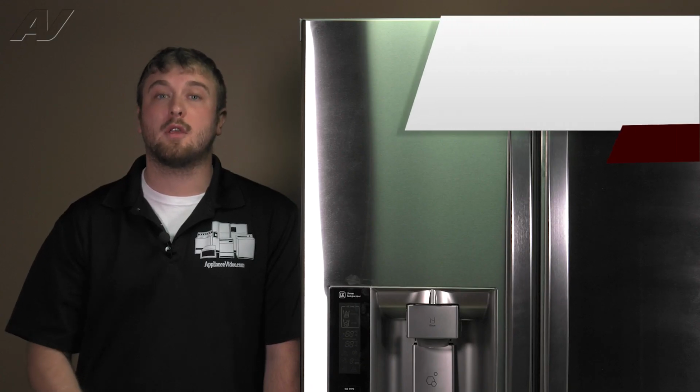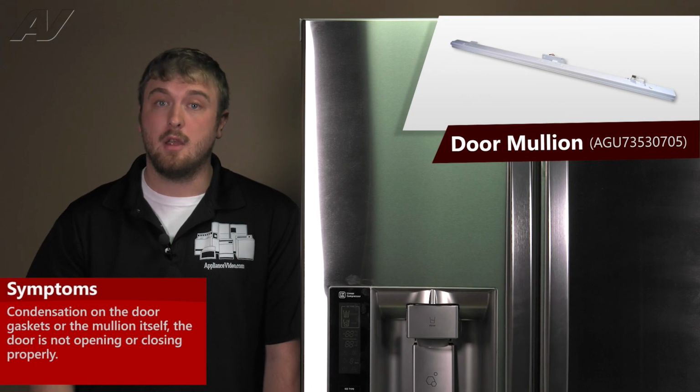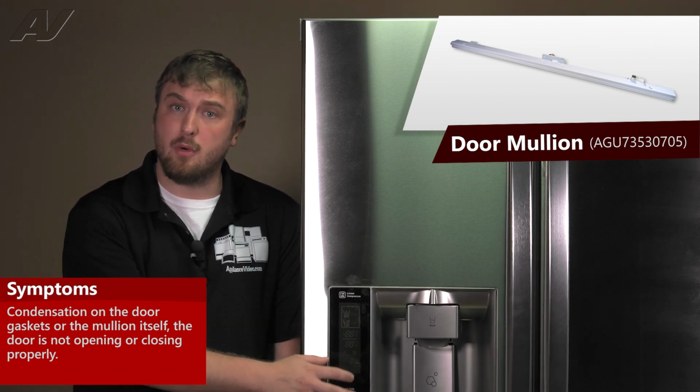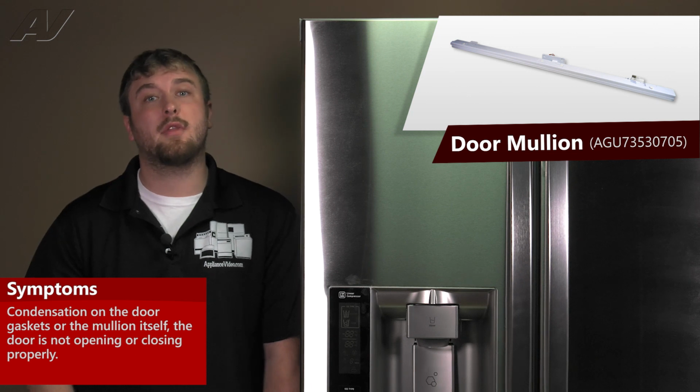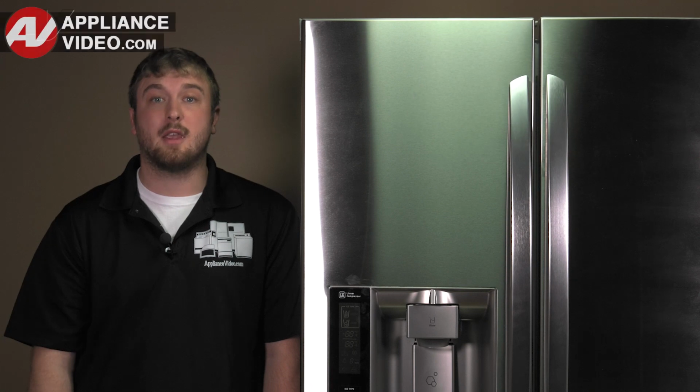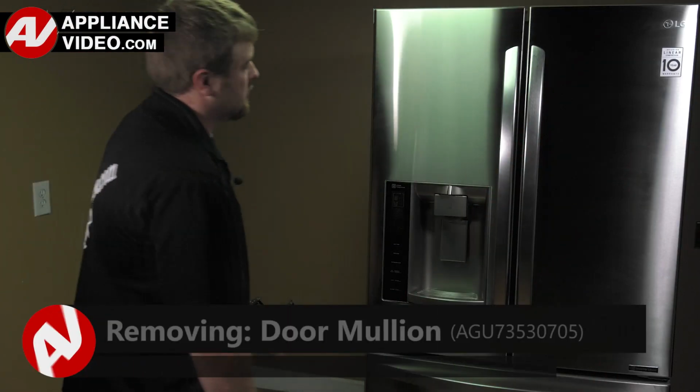A faulty door mullion, also known as the flipper assembly, would often result in condensation on the seals or on the front portion of your mullion, or it could be that the door is not closing correctly or not opening correctly. Now, click on the link below to view this repair video.